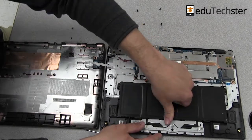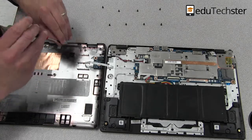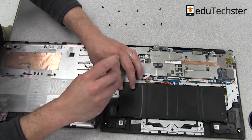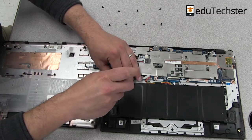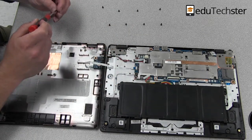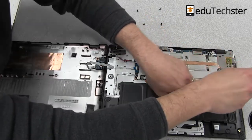We're going to go ahead and put that battery in. You do want to make sure that at the very bottom you get these two little clips, and that they get inserted inside that little slot on the bottom bracket. Otherwise it can be a little bit troublesome getting that battery back in. You can go ahead and replace those screws on the left and the right-hand side. Sometimes it's easier to connect the battery before you do that, but I like to make sure that it's secured down first.